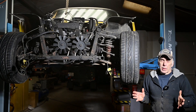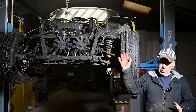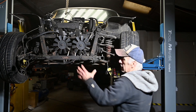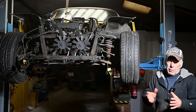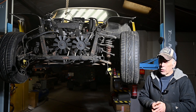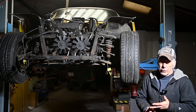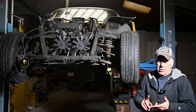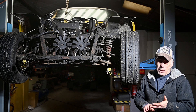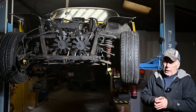To inspect the timing gear we will need to remove the timing cover, and that entails a couple of actions. I have first removed the bonnet or hood on this car — it makes it easier to work on. The radiator has also been removed and I drained the system of its cooling liquid, because the radiator was leaking as well. The next things you need to do are: remove the sump on the bottom, remove the fuel pump, remove the pulley on the crankshaft, undo 11 bolts on the timing cover, and you may also need to remove the alternator and the v-belt.